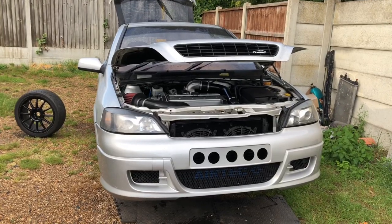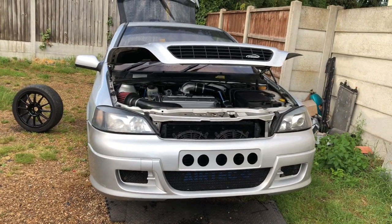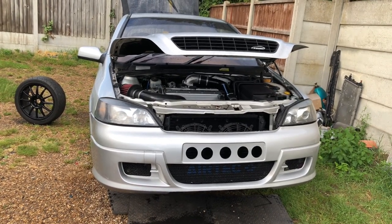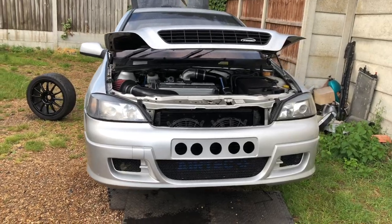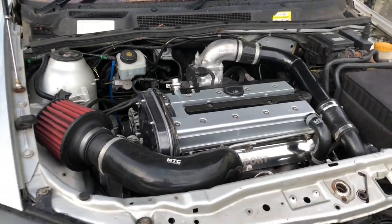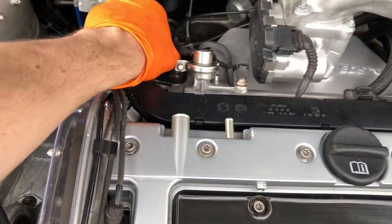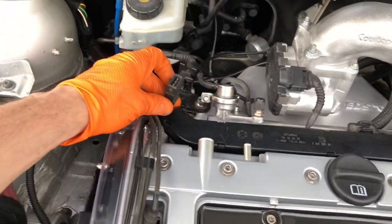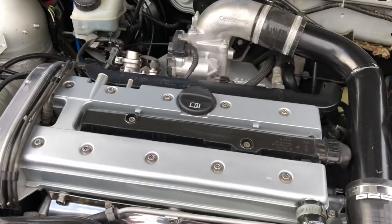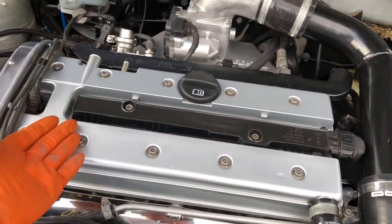It's time to start this engine up, so let's go over the engine startup procedure to help people out. This is the part where people make mistakes that irreversibly damage their engine for life. The first 10 to 20 seconds of a brand new engine build is the time you're going to cause the most damage - and it's the time everyone damages an engine. Go around and disconnect your crank sensor. Disconnecting the crank sensor is going to disable the fuel pump so there's no fuel going to the injectors to flood the cylinders, and it's also going to stop spark.